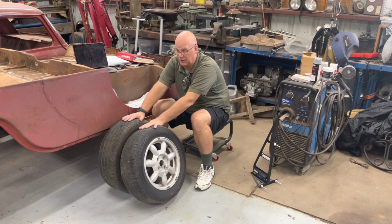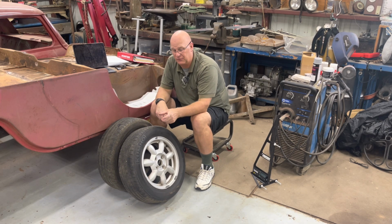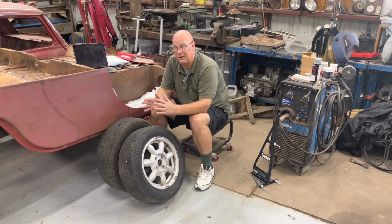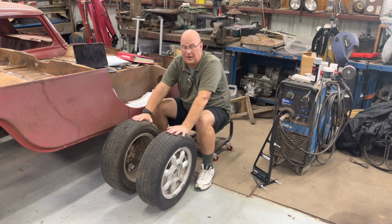Now, like the Miata, you can't get much more than 1 degree unless you replace the lower control arms and the ball joint. It won't do it. The Porsche, you're not supposed to get more than about 1 degree because it's designed so not to have that much. That's camber.